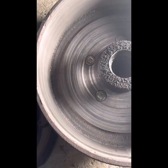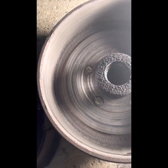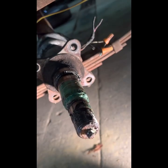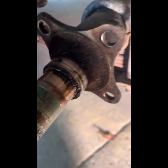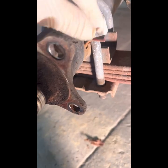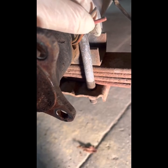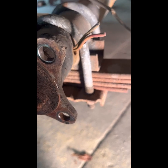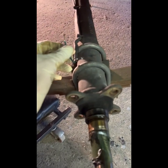So I had to go ahead and get a whole new rotor, but I got the wrong size and wrong bolt pattern, so of course I have to take it back. But you can see this is it with it off. While you're at it, put grease on all that stuff because it helps with rust and wear and tear. Here's that line — how the manufacturer put it in through there — I hear that it likes to rub and cause cuts from vibration, so I put it on top of the axle.